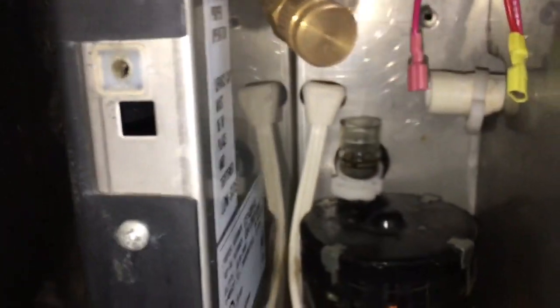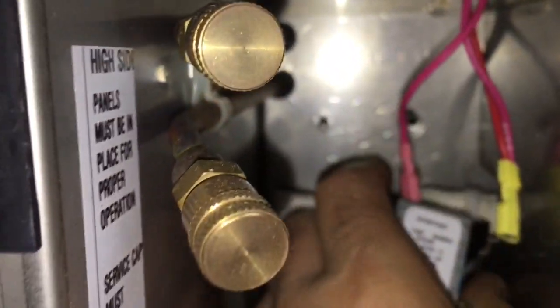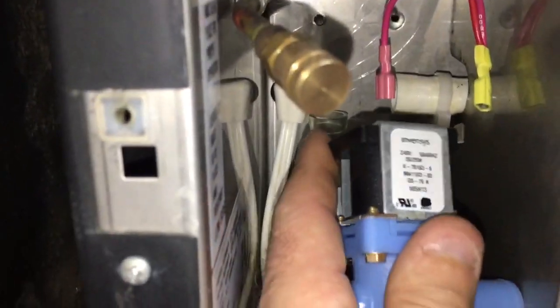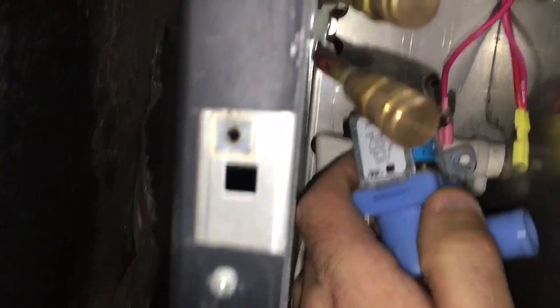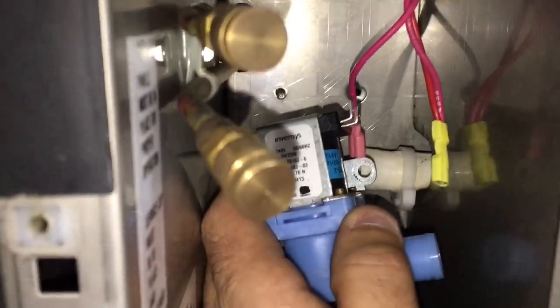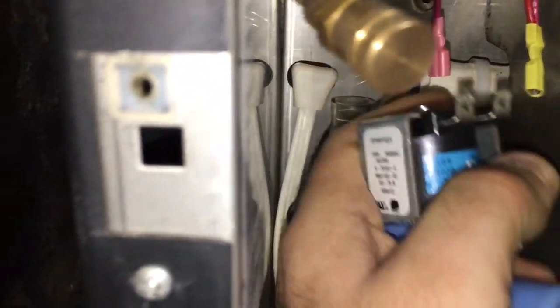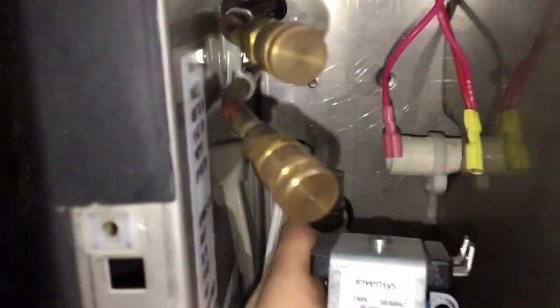Putting this valve in — there's a screw that goes through from the back, but you don't need to take that out. This little valve just slides over it; it's a locating pin. Just use the screw. You don't have to get into the back of the machine at all — just undo the clamps from here. Turn the power off to the machine, undo the screw, take off the two wires, undo the clamps, in and out — slam bam, thank you ma'am.